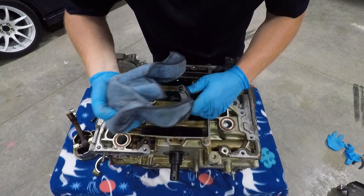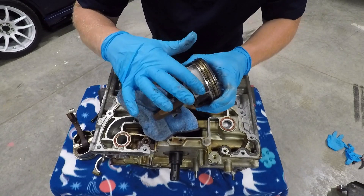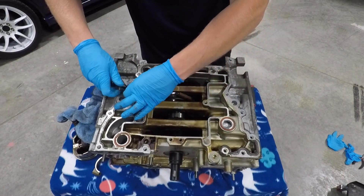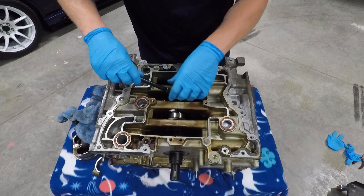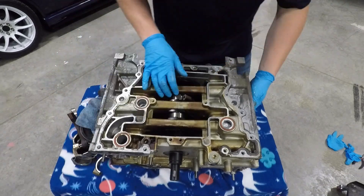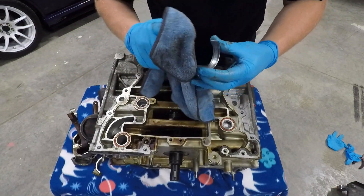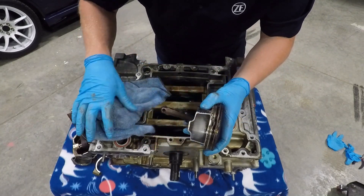The sidewalls on these things are just eaten up. The skirt of the piston is eaten up — same story, valleys in the cylinder wall, the skirt is rough like 60-grit sandpaper. All three cylinders I've removed — the cylinder wall and piston skirt are completely gouged and eaten up. A lot of bearing material floating around in the oil. Cylinder three: the bearing is lost, there it goes out of the rod. The rod bearing material is everywhere, and the piston skirt is completely eaten up.